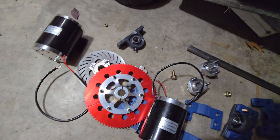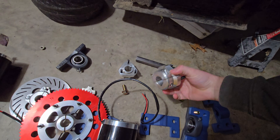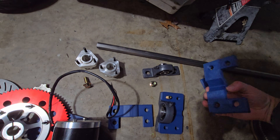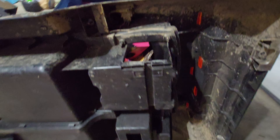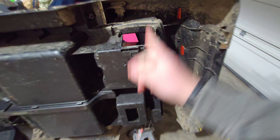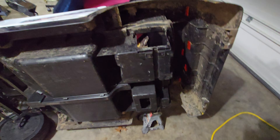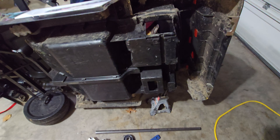I've got a disc brake, I've got a caliper somewhere, I've got some go-kart hubs — these are the metric size. There's also a two and a half inch standard American size. I've got some bearing carriers. I 3D printed these brackets to try and sandwich the bearing carrier with the plastic. What I'm going to do is cut here to make room for the axle, mount the axle and the motor, and see if I can get everything to line up. I want to keep the original axle center in the center of the car. Let's see how this goes.